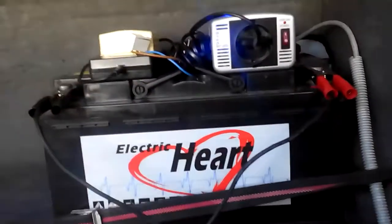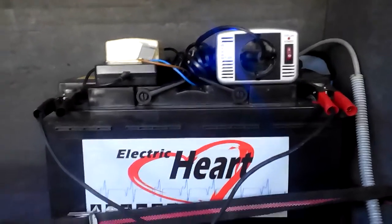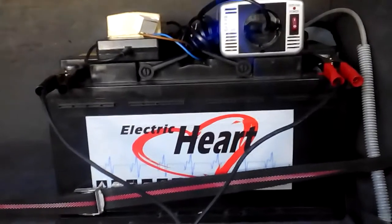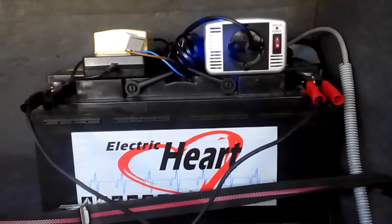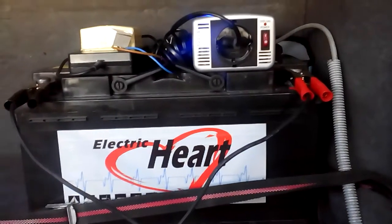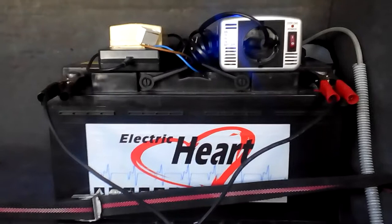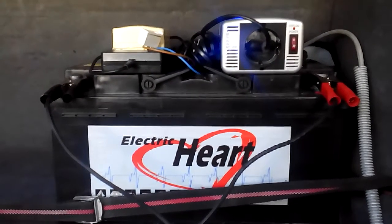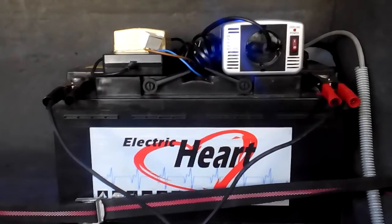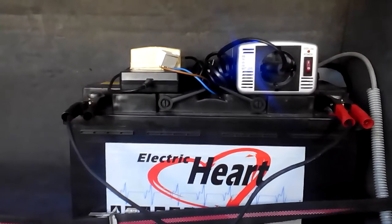We experimented with a completely loaded battery. We've done 300 kilometers, something like three and a half hours. This battery is 100 amps. We are consuming three amps and the converter maybe something like 10 amps total, so we are supposed to be good for about 10 hours — divide by two and a five-hour trip could be planned.